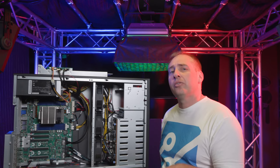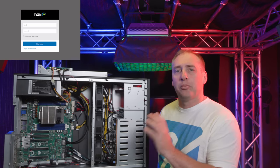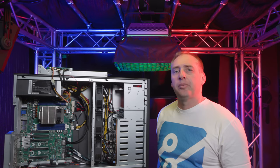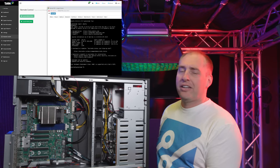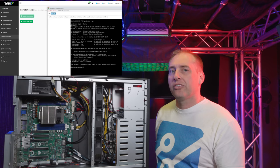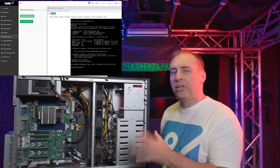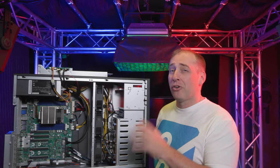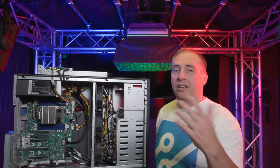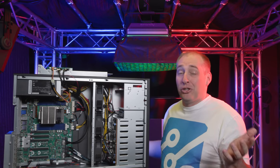Now let's get to management. This system uses the ASPEED AST2500 Baseboard Management Controller, and Tyan has its version of MegaRAC SPX on the server. You get a web interface, some Redfish capabilities, and a really commonly used feature — an HTML5 iKVM solution with remote media. On these Tyan servers, you can get that iKVM feature without paying an extra license cost, unlike Dell iDRAC or HPE iLO where you usually have to pay. You can also do all your firmware updates — BIOS or BMC — directly from the web interface without needing another license fee. That's something Supermicro makes you pay around $20 for, but not here.